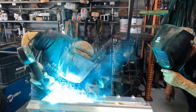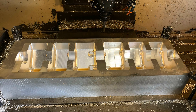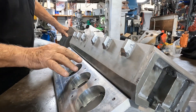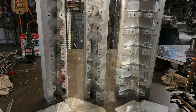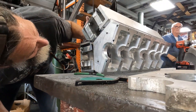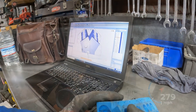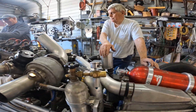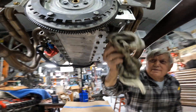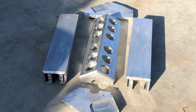Welcome back everyone. Peter Dima and Kevin Brown have a new 5-liter V12 in the works, and we wanted to show everyone some of the initial steps on how the components are actually welded together by expert welder Eric Hartop. Pete and Kevin have high aspirations that their new V12 will produce over 2.5 horsepower per cubic inch and make between 750 and 800 horsepower with capabilities turning up to 12,000 RPM. Pete and Kevin have designed and built over 100 prototype engines and don't mind sharing their knowledge when it comes to making horsepower.